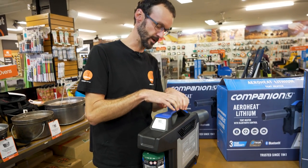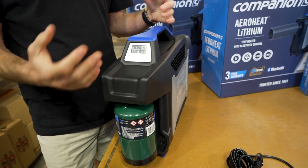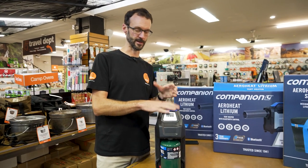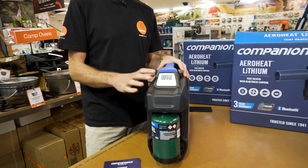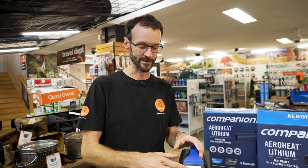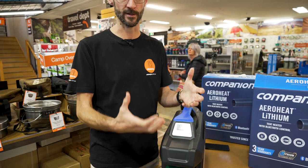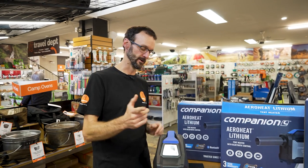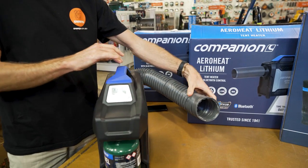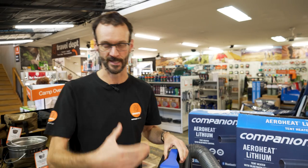While the unit can sit outside the tent, it still needs to be protected from wind and rain to operate properly — you can't leave it out on a rainy night. One important note: when you turn it off, it runs a 90 second cool-down before you can turn it back on. This applies even if you've just briefly switched it on. So make sure the duct is properly in place before turning on, because if you accidentally knock it off and get an error code, you'll have to wait 90 seconds every time.